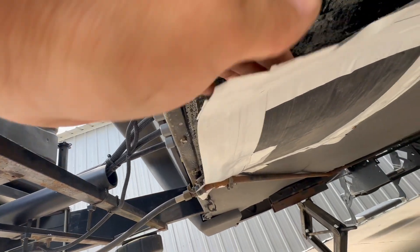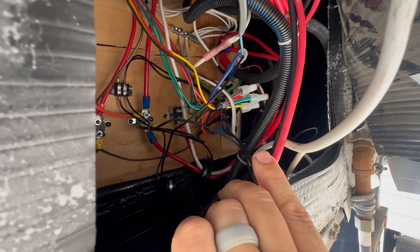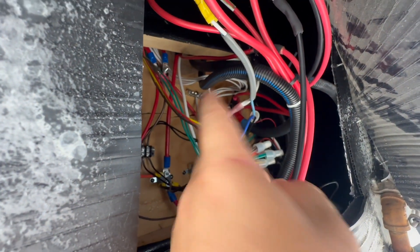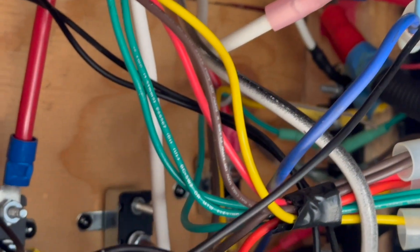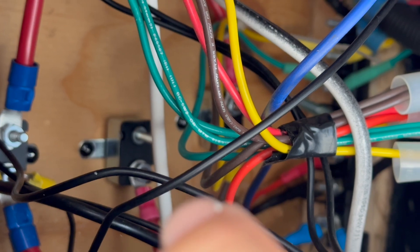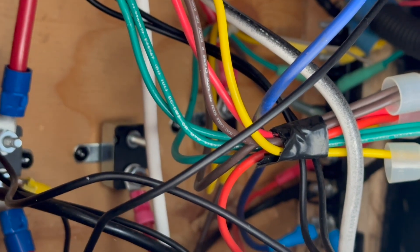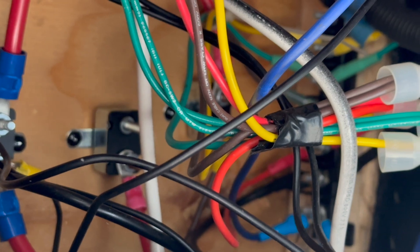Under the tongue area there's an access panel here, and this is where we made that connection — you can see some of our splice up here. There's a white and red, and we just connected that to the black and red of the solar. There is a grounding bolt here. The white wire coming out was connected to that bolt, but I thought it went to the grounding bus bar up there. Right there is where that breaker is where you disconnect for the solar input — that's where the solar wire comes from the roof into this area, so you disconnect it there and that's where we end up tying together.